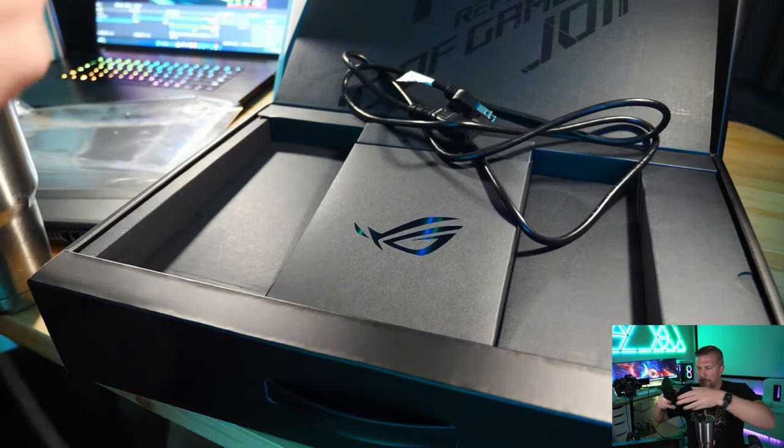Right now we're doing like 105 to 108 on our TDP, and a higher TDP 4060 should be able to hit 140 watts consistently in this test. So at 140 watts consistently, I would certainly expect higher clocks and even better performance. Let's see what we get. Right now our boost clocks are at 2565. We're pretty much locked around there, which is interesting.